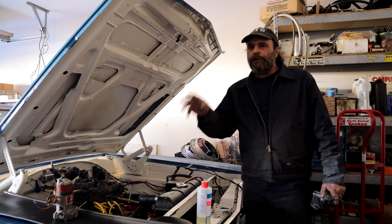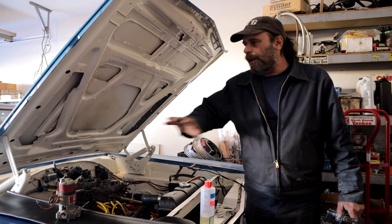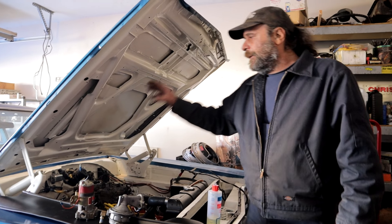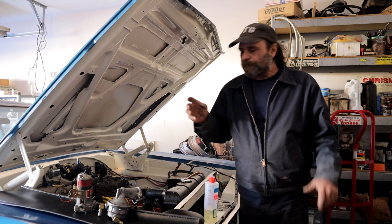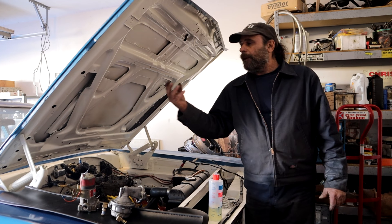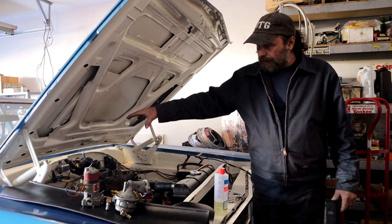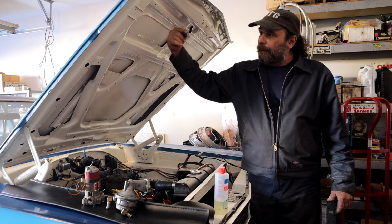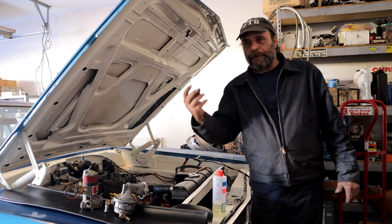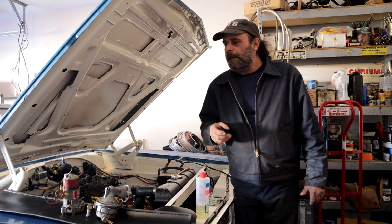The type of pump you choose is based on the circumstance of the car. On this car we have a stock gas tank — no sump, no fuel cell. So the fuel pump has to pull: it has to be able to pull the fuel from inside the tank, up through the pickup, down to where the pump is mounted. The pump will be mounted at or below the level of fuel in the tank, so we need a pump that's capable of pulling.